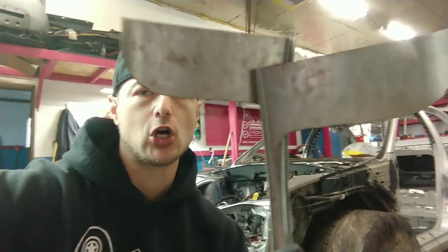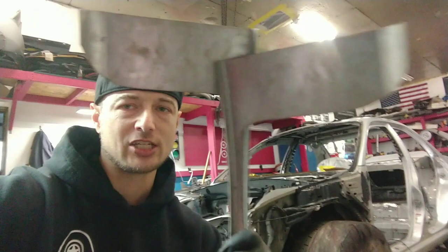I'm a big firm believer of quality over content. When I say that these tubs are replicated in the same fashion and that's why they fit every single time, it's because my templates themselves are steel. This is the contour piece that gets strapped to the actual 9-inch tub itself. They are clamped to it, traced, and then cut out. This is for the GD body style, which starts from 2002 and ended in 2007. Understand that each individual body or model will have its own tub placement. If you're looking for tubs, get a hold of me.